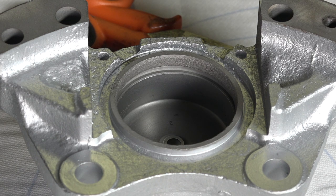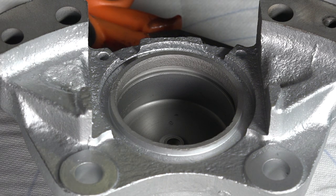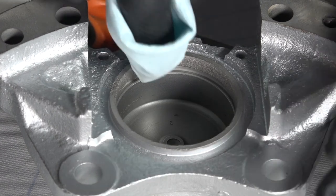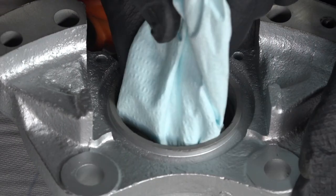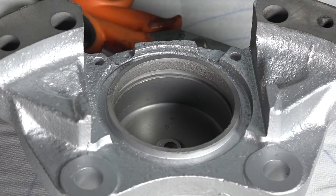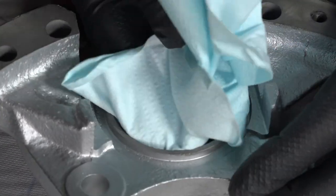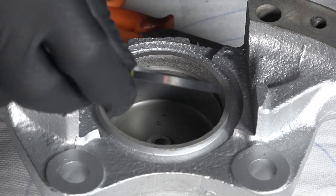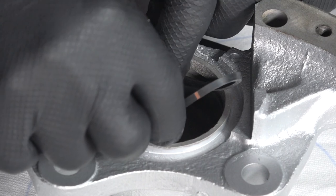The first thing I'm going to do now is fit the square seal into the groove inside the cylinder. I'll rub it one more time to make sure there's no garbage or debris inside, then put it into place.